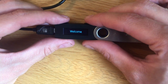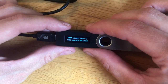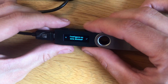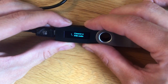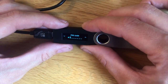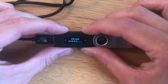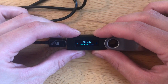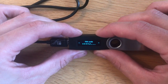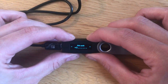Now let's have a look at initializing the device. The first thing you'll receive on screen once connected is a welcome notice explaining the differences between the buttons. You'll then get an option to configure as a new device. Click the tick button and the first thing it'll do is prompt you to choose a new pin code. You can do more than four numbers — you can choose six, seven, or eight digits. Once completed, click both buttons at the top simultaneously to confirm, then it'll ask you to confirm your pin code by re-entering it.